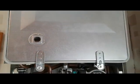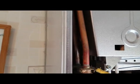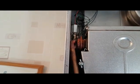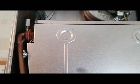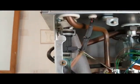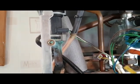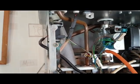We'll take this cover off and look inside. The back pipe is the cold water inlet going up into the main heat exchanger, then goes through the heat exchanger like a coil through it, and then back out. This is the hot outlet going out to the taps, and this is the hot water sensor which senses the hot water going to the taps — that's the flow of the hot water circuit.